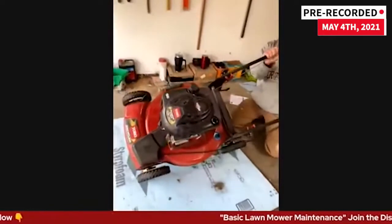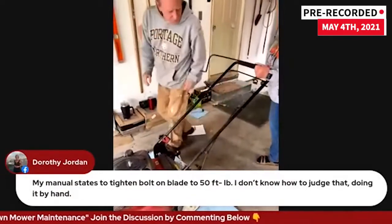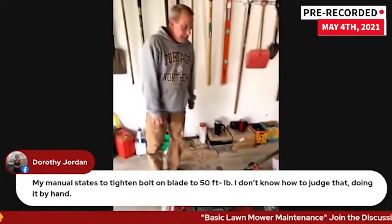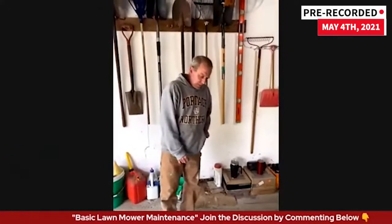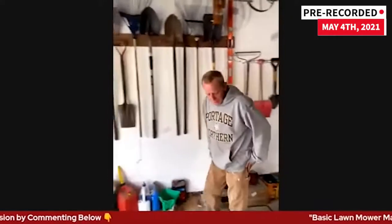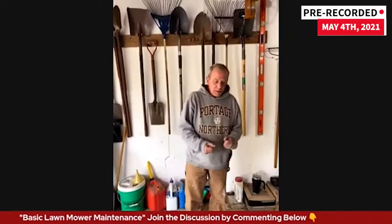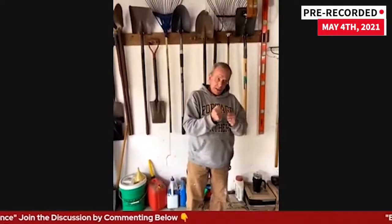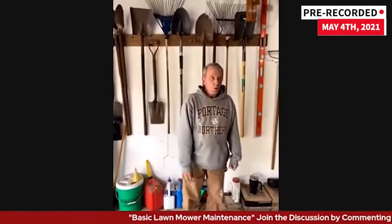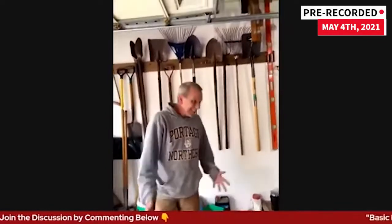The other part we're going to do is the air filter. With the oil, this is typical lawnmower small engine oil. In the manual, it's going to say what kind of oil it wants. I know this takes about 20 ounces. I'm going to put a little bit in, let it sit and settle, put the dipstick back on, let the oil settle out as I'm working on other things, and then I'll check it. If you have a choice when shopping for your oil, buy the one with the wide clear side so you can read how much is in it — it's like a measuring cup.